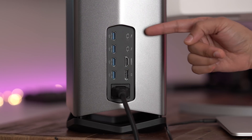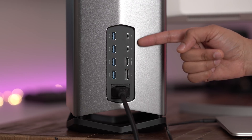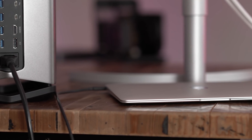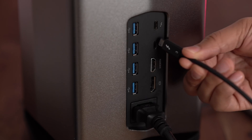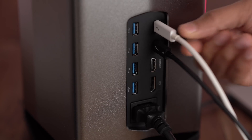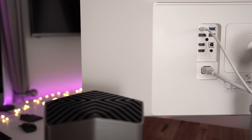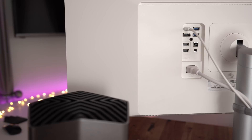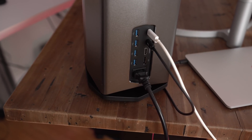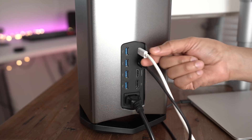Like the previous version, you still have your four USB 3.1 Gen 1 ports, and you have two Thunderbolt 3 ports. Blackmagic is again using Intel's Titan Ridge Thunderbolt 3 controller, and this presents the key advantage of being able to connect directly to a Thunderbolt 3 enabled display, like the LG UltraFine 5K display. In my case, I'm connecting directly to LG's Ultra Wide 5K 2K display, which is more like 4.5K. Nonetheless, it works, it looks great, it runs at 60 hertz. If you have an LG UltraFine 5K display, this is one of the primary selling points of either the Blackmagic eGPU or the eGPU Pro.